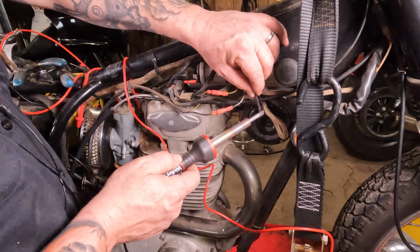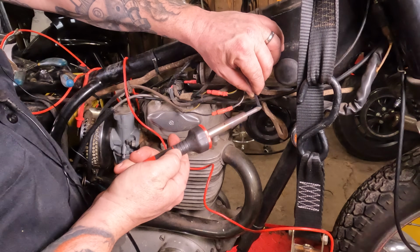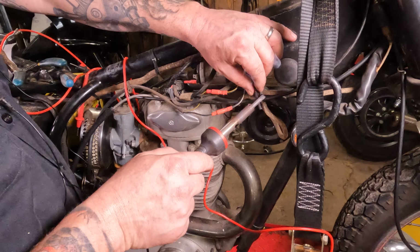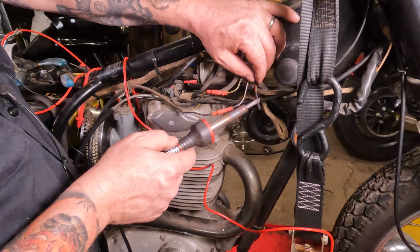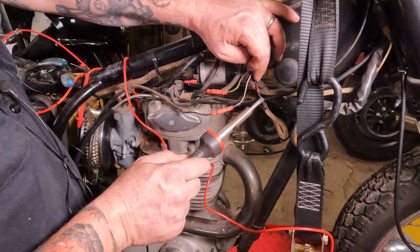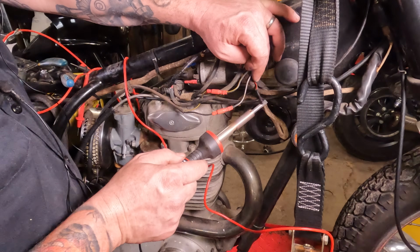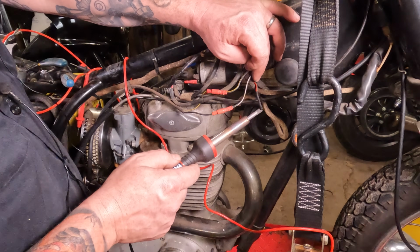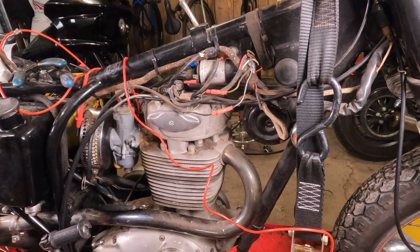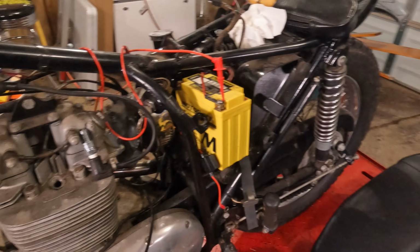Take your soldering iron, or lighter if you're brave. There we go. Go up and... Crap, don't knock it off the wire before you're done. Then go up and down the side of the shrink tube with the soldering iron. Just localize and melt it on there. All right. Seems to stick on there a little bit better than wrapping electrical tape around it. There's your tech tip for the day.